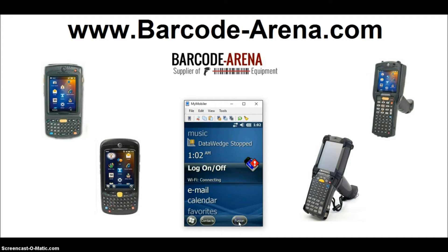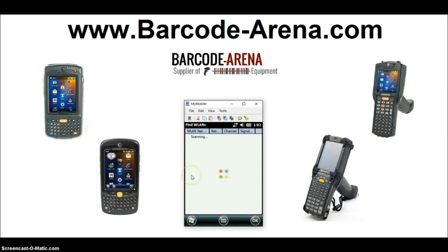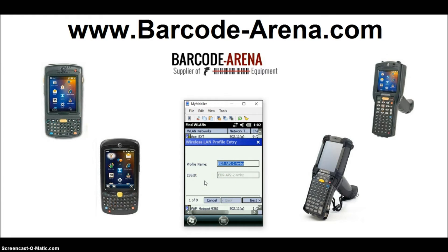Click OK. Open Fusion back up and find your Wireless Local Area Networks to pull up Wi-Fi networks within range. It's going to pull up our office networks and a whole bunch of Wi-Fi networks around the area. Tap yours, then hold your stylus over it a second time to right-click it and create your profile. Here is your setup wizard. Before you go through this wizard, check with your IT or network administrator to verify what version of security your Wi-Fi network is. It is imperative to know the security mode and encryption method — if you have one setting off, it's not going to work.